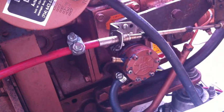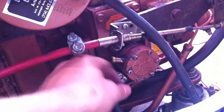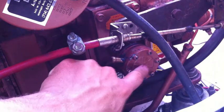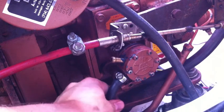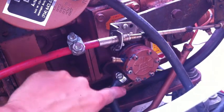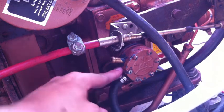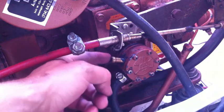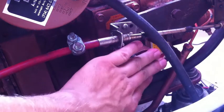I've already reinstalled the fuel pump. What I did was take the plate off, spray it out with some WD-40, and clean it out. We should have fuel in the line going directly to the pump. We're going to crank it over a few times and see if we get fuel coming out of this nozzle — if fuel comes out, we know the pump is fine and we'll work from there.